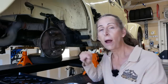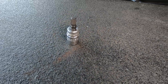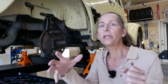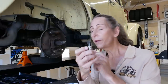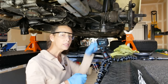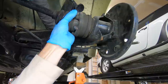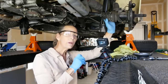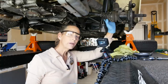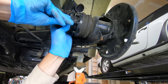To get the CV joints off properly, there's a special tool called 12-point or triple square — they look like a spline. This is an 8 millimeter. If you try to use a hex in there, you risk rounding off the inside and then you're really in a mess. Make sure you have the right tool. Before using it, we want to make sure the inside of these bolts is completely clean — use a pick to go into each one and make sure there's no dirt or grease in there. The last thing you want to do is strip one of these. Maybe hit them with a little bit of spray as well.